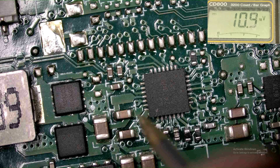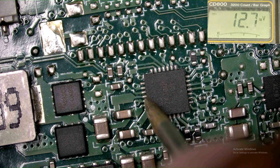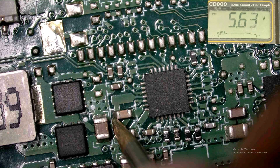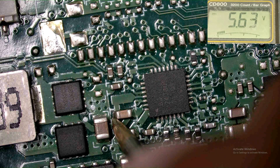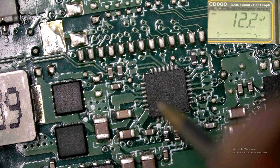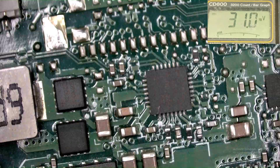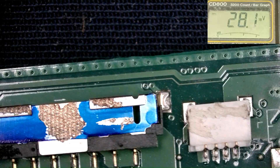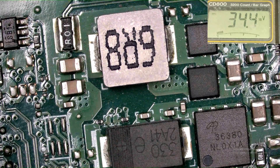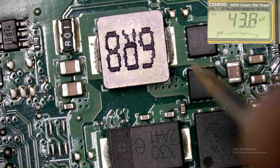This is also okay. I need to check pins 21, 22, 23, 24, and 26. This one is 5.63V — here there should be 6V, but this may be okay, and sometimes meter error can be a problem. BQ chip voltages are okay, and it will be confirmed when I see the battery is charging. These are the 2 MOSFETs for charging the battery.